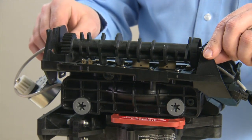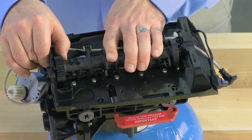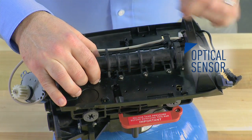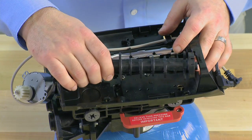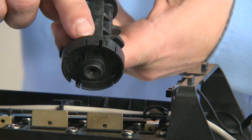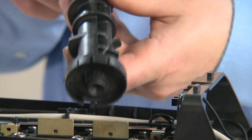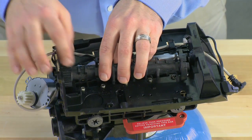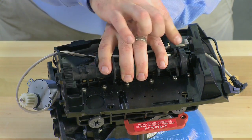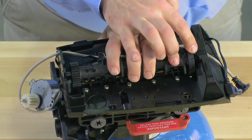We can now move to removal of the cam. We remove the cam by pressing down and to the back of the unit. We want to get the cam as far to the back as we can so that we can clear the optical sensor in the front. Once we clear the optical sensor, the springs will move the cam out of the way, and we can pull forward and remove it from the body. To reinstall the cam, we need to make sure we line up the arrow in the top of the cam with the arrow in the top of the body. We pull the gear as far to the back as possible, make sure our arrows are lined up, pull the cam down and over until we clear the optical sensor, then pull forward and engage the cam to the front of the unit.